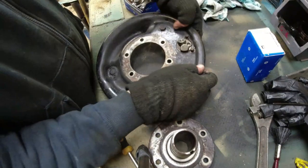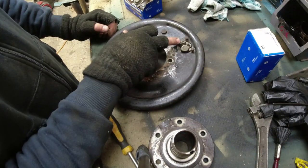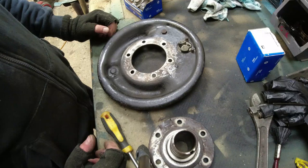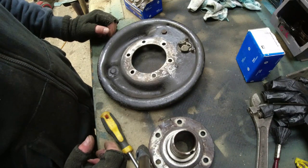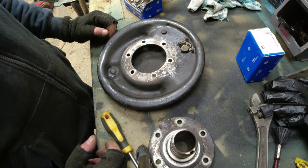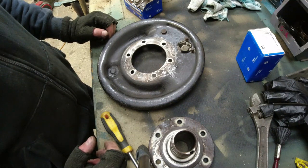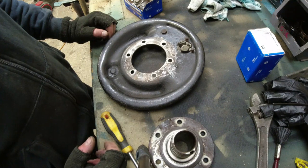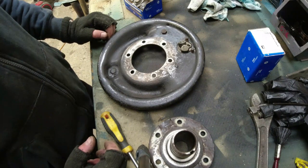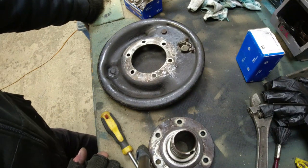Right, so wheel cylinder is on. Now, bearing in mind this is the driver's side, the bleed nipple goes at the top, and the brake pipe was then going down the front of the axle. And I don't seem to recall it being that way around, but then I get confused, don't I? Because it's been a while since I touched a Series 3, and the last Series 3 I played around with was Sandy. That's a 1980 car, and there was a big changeover in July 1980. So the brakes on the back of the car pre-July or pre-August 1980 were different, allegedly, from those post. Oh, for goodness' sake, you've got to get this right in a minute, aren't you?